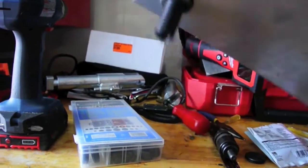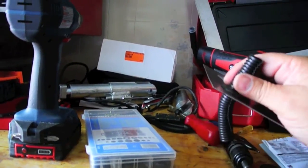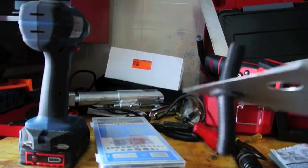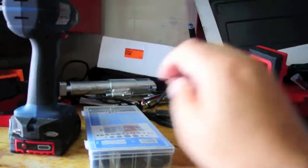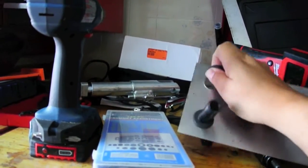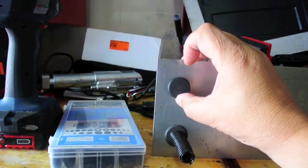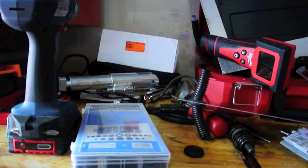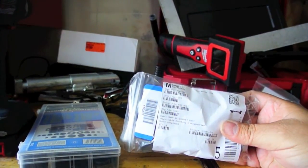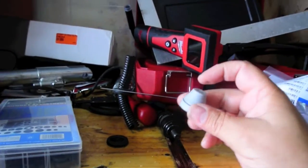I'm practicing here with just a piece of sheet metal. This first option is a grommet that goes into a three-quarter inch hole, and I just put a little piece of half-inch loom through here — so that's one possibility. The other possibility is this kit, which looks like a grommet except it has a membrane on one side. It says it's within about a sixteenth or thirty-second of an inch of the recommended hole size, so it would certainly fit, and then you just puncture a hole when you're done. I can buy them individually at Mouser.com, which is a big online electronics house.